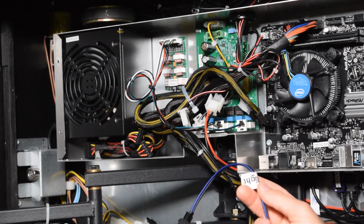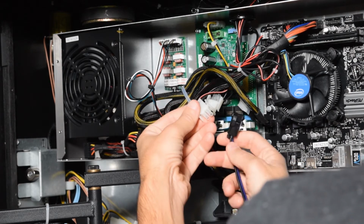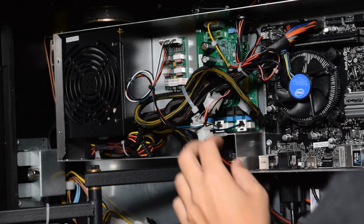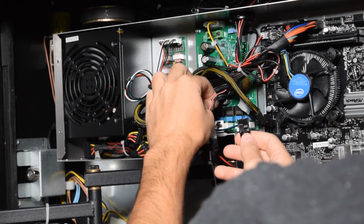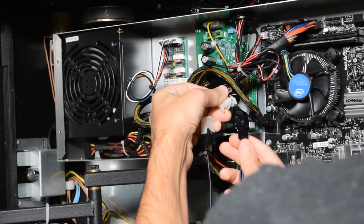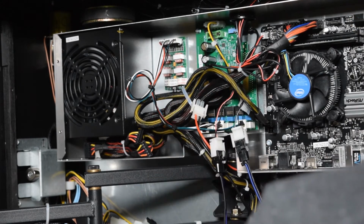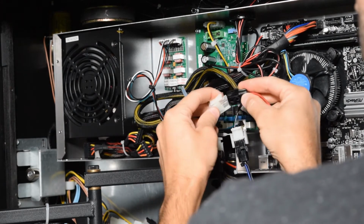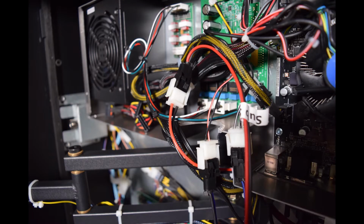Now it is time to connect the wiring harness to the speaker cables. Start with the wiring harness cable labeled right and plug it into the red and white / black cable for the backbox speakers. Then connect the other blue and black cable from the wiring harness to the gray and white / black cable for the other backbox speakers. Now connect the red and black cables marked sub to the red and black cables in the backbox. Here is what it should look like when properly installed.